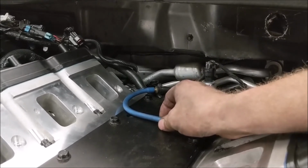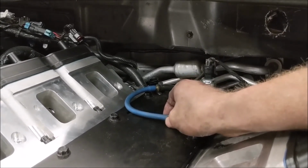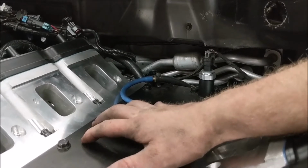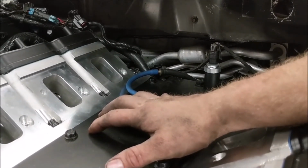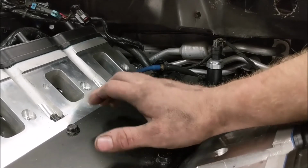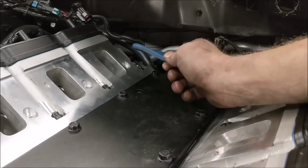So he still has a vacuum switch, but he's also got a vacuum pump, and he put a vacuum pump in the back so he could take this out and not have the issue of the lack of intake vacuum, because this is a performance motor. He was having a lot of trouble before getting the valves to fully shut, so it'd be loud at idle, and then as soon as he got moving where he had a little bit of vacuum, it'd be quiet. That was kind of annoying for him, so he's very picky that way, which is cool.